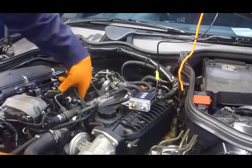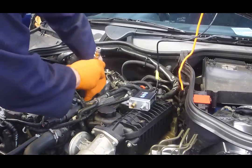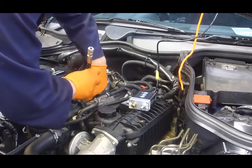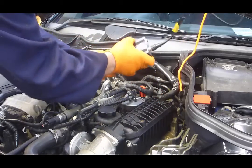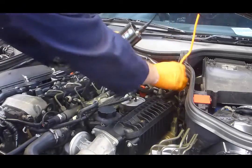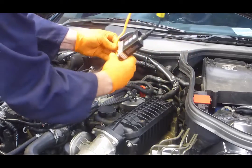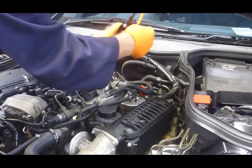Our dummy glow plug is already installed. We connect our pressure hose — the conversion hose — and then connect the pressure transducer to the conversion hose. We're connected to channel A of PicoScope to support our pressure transducer.